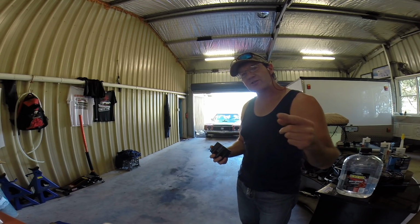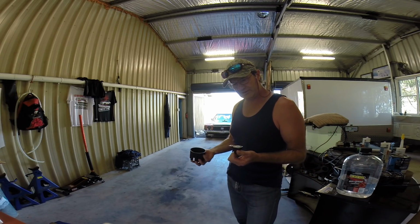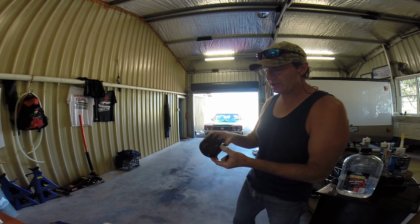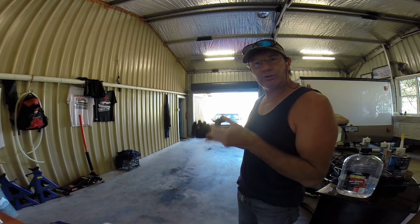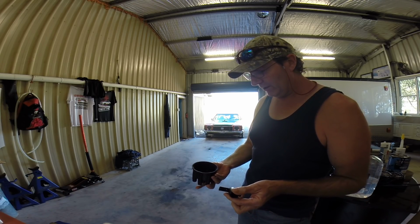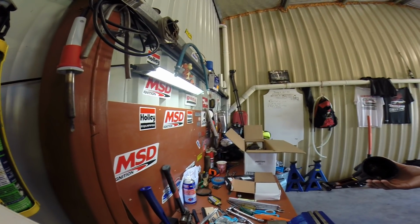But running beautiful. I steepened up the curve a little bit with the timing on the graph, and it's made it really snappy. It's unbelievable. I checked the phasing on my rotor button versus where it fires. I was actually going to do a vid on it, but it's not easy to film when it's in the back of the motor, the dizzy and everything, so I didn't bother. But what I'll show you now is where it's actually sparking corresponding on the rotor button. I'll turn it around a little bit and show you guys.